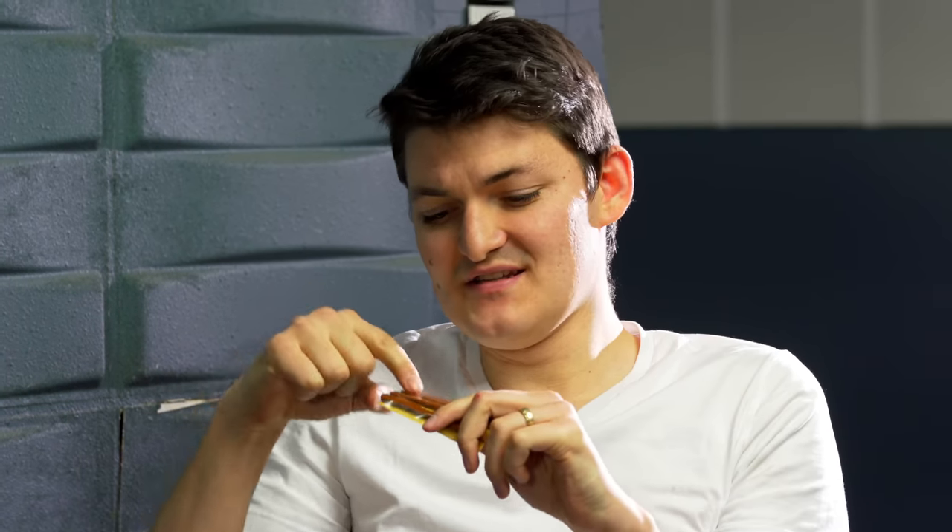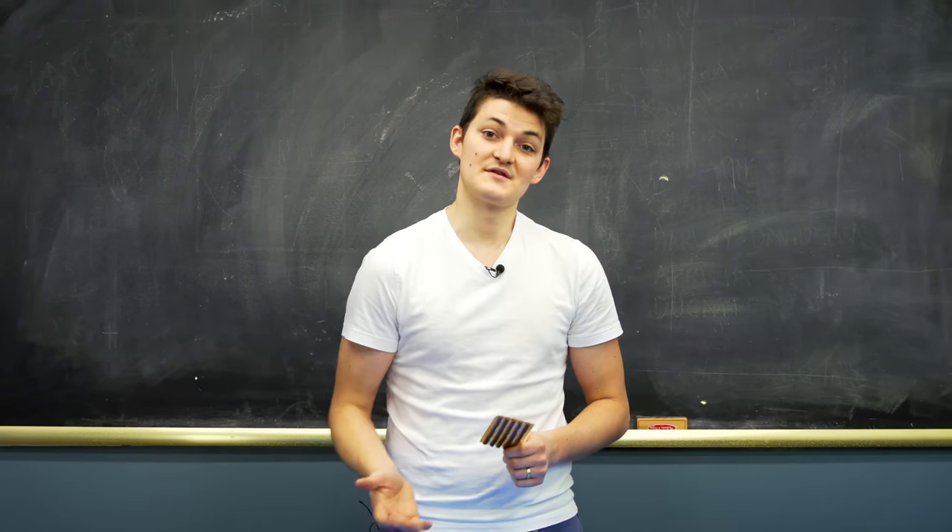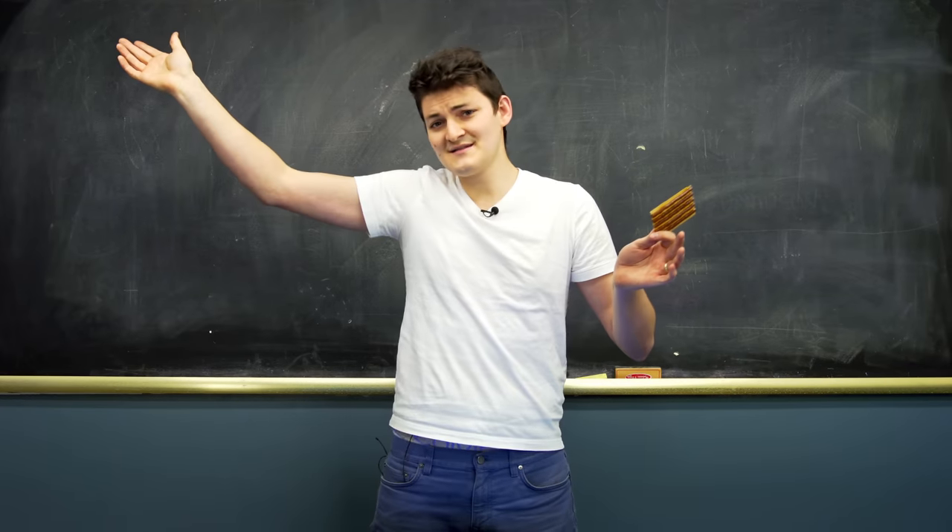My conclusions? The video will have to admit that the internal patch is safest. But from our test, rope plugs are safe enough for me — we saw that their sticky seal is resilient, and the ability to fix nearly any flat from outside the tire? Come on. That is why I've been using rope plugs for years; I currently have three in my various vehicles with no plans to replace the tires till they're bald. As for Dynaplug — they're not sticky, so when they pop loose they stay loose. If you're gonna ride on it indefinitely, that's a big sacrifice in the name of slickness. The kit is a few inches smaller, the difficulty a few IQ points easier, the process a few seconds faster — but unless you belong to an F1 pit crew, who cares?